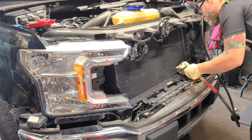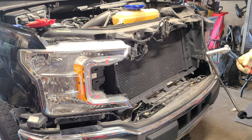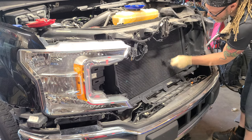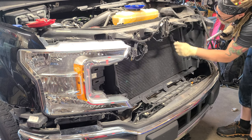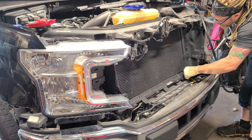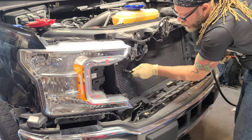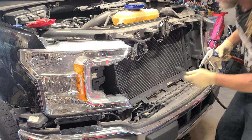There's little stuff like rocks in the radiator. I'm going to use a nylon brush — he didn't ask me to, but I figured since I'm in here, just get some of this debris out. Use a nylon brush, do NOT use a wire brush unless it's copper — you don't want to mess up your fins on your radiator. A few rocks and grit in there can possibly compromise the cooling system later, so a little air and a sweep while you're in here doesn't hurt.